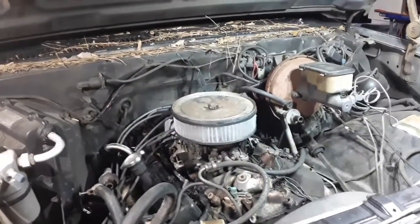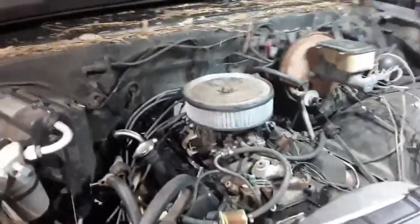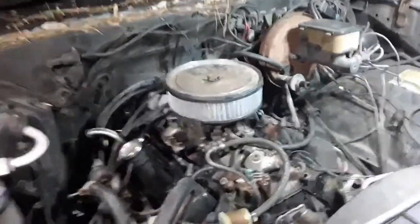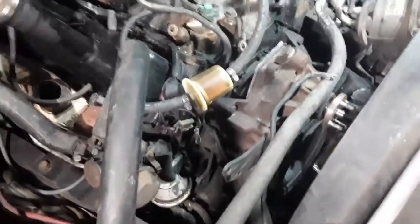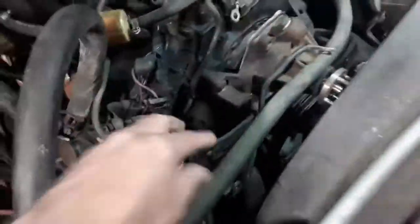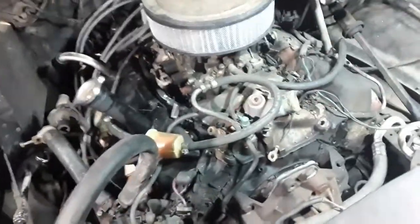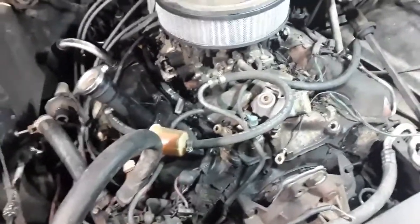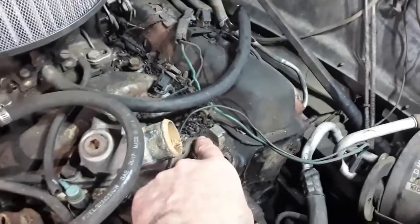It's been a couple of days since I've been able to get under the hood of this. First, as you can see, I started by taking off all the accessories because there are a lot of little brackets and stuff that bolt to the heads, and my goal is to take the heads off. One thing you may want to do is check the location of where all your intake bolts are to see if they've got a bunch of junk around them.